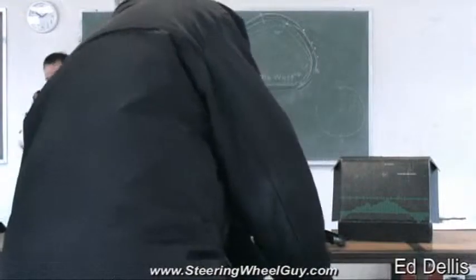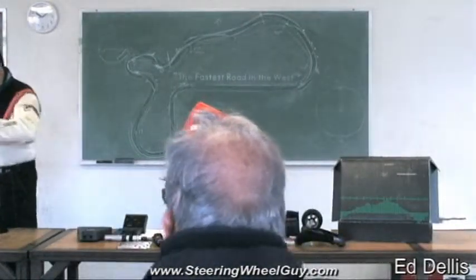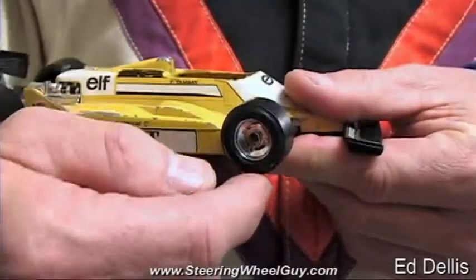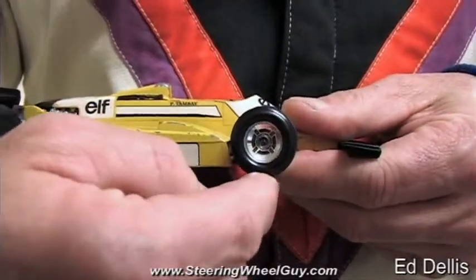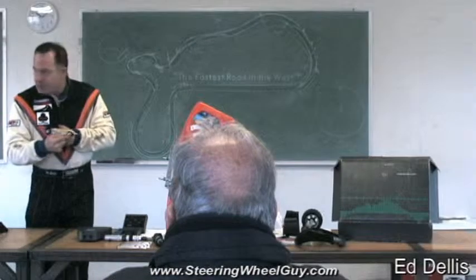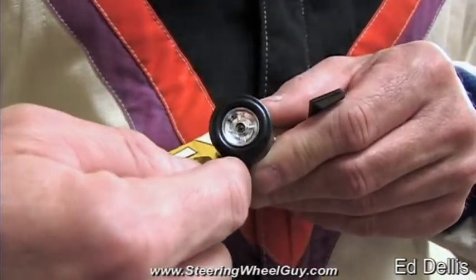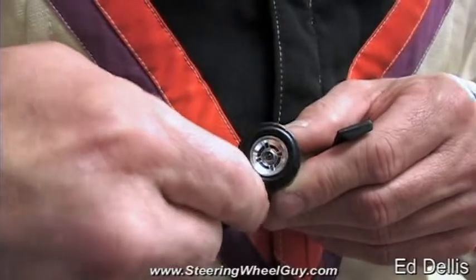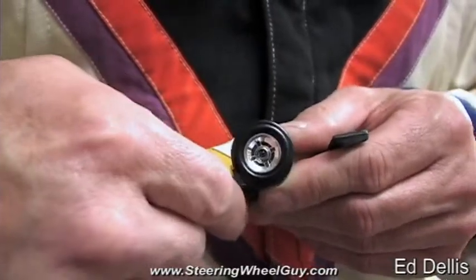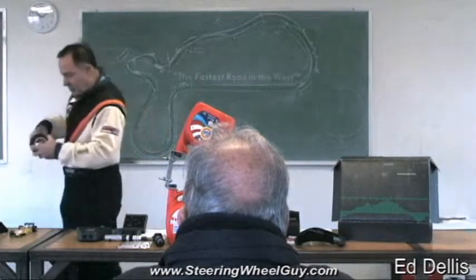Now I can't twist this, so bear with me here a second. Since this ball joint is vertical up and down, if I push sideways on the bottom of the wheel, it's just going to try to slide it this way. But if I incline it back and I go to the bottom and I push — look what happens. It turns the steering wheel.